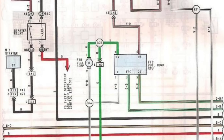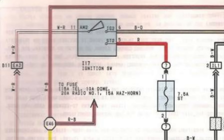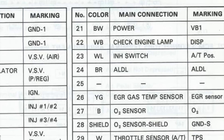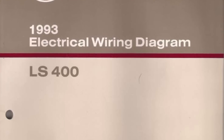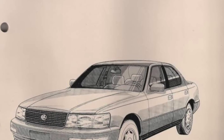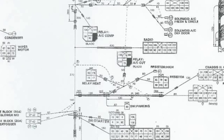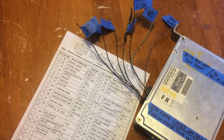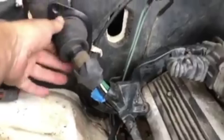Working out the electrical took some time but wasn't overly difficult. It was a matter of studying the wiring diagrams from the LS400 and then studying the wiring diagram for the Trooper — I got all of this from the factory manual and downloaded the Lexus stuff off the internet. I was able to study the Isuzu Trooper wiring loom layout, make sure I knew where all the wires were, then began the process of marking them, tagging them, and eventually cutting and splicing them to get all the power and signals to all the right places so the engine would run properly and all the gauges would function.